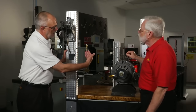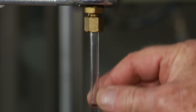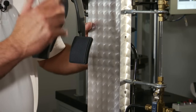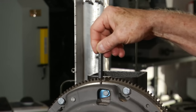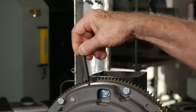Now let's add the air bubble. When I open this valve, we're going to add this air bubble to the system — it'll compress first. The fluid is compressing the air bubble, which gives us a spongy feel. We lose pedal travel, we lose plate lift on the clutch, and we don't get a clean clutch release. We're talking about gear clash, grind, and inability to select reverse and first from a standing start. So we've got to get that air bubble out.